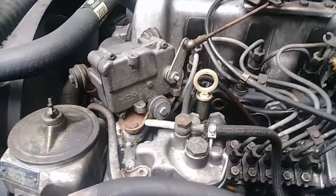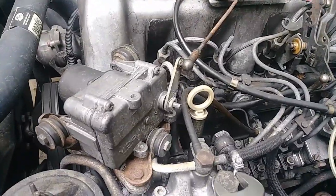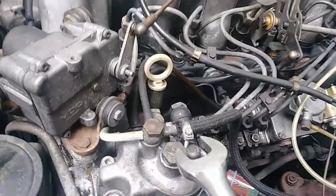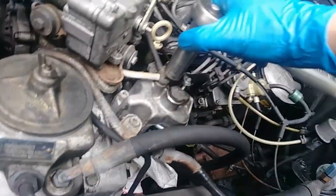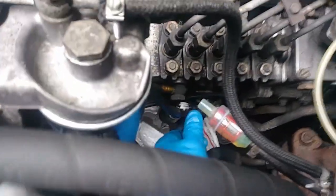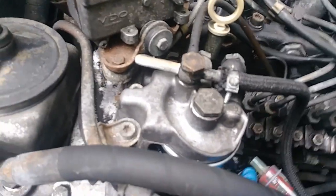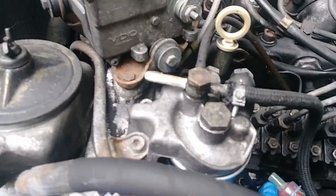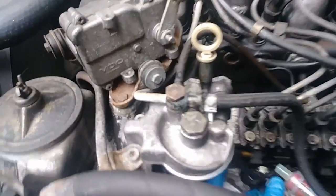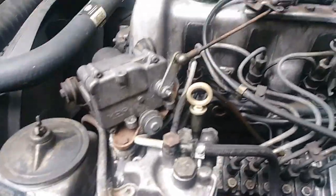You can see the container — the little round one. I'm gonna keep pumping until the diesel comes out of this small one. There we go. Putting the fuel filter back in. A lot of bubbles — so I can just tighten this.